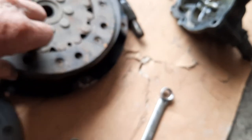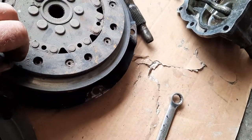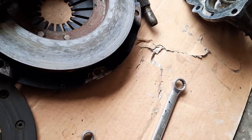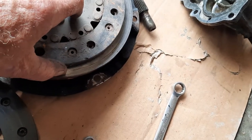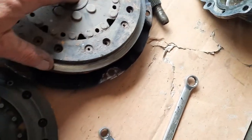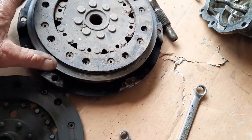I did have another plate out of the 1300 - this one is in reasonable shape, not clean, it was attached to a flywheel and pressure plate that rusted out, but that'll clean off. The issue is the inner is the same but the outer is much smaller - this is a 180mm whereas that one's a 200mm. This one is off the 1300, that one off the 1600 that's going into it.